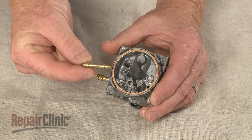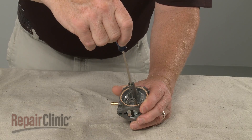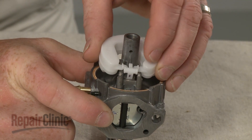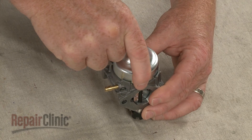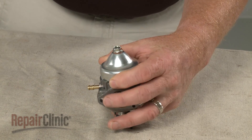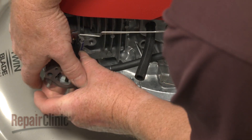Reinstall or replace the main nozzle by inserting it, long end first, into the carburetor tube. Re-thread the main jet. Confirm that the needle is attached to the float, then align the needle and float on the carburetor and insert the float pin to secure. Continue the carburetor re-assembly by confirming that the bowl gasket is in place, then replace the bowl and thread and tighten the screw to secure. Re-install the carburetor by first connecting the governor rod and throttle return spring to the throttle arm. Attach the fuel line and secure it with the clamp.